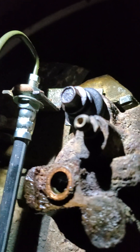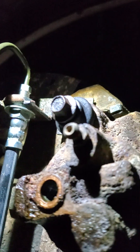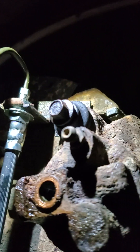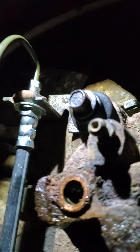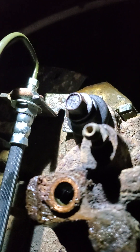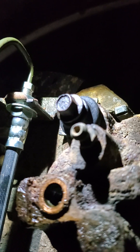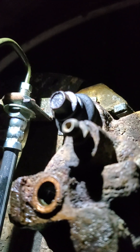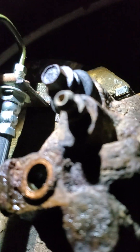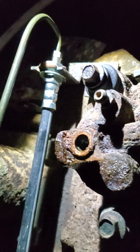This is a brand new line, so there's going to be some air coming out — these will have to be bled. Because air compresses, brake fluid doesn't. That's why if you have air in your lines your brake pedal will go to the floor — the air will compress but the brake fluid won't. So when you get all of the air out of the line and you push that pedal, there's no sponge because it's all fluid, and it just locks up the brakes.